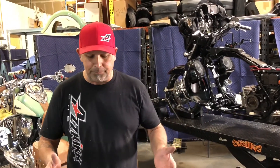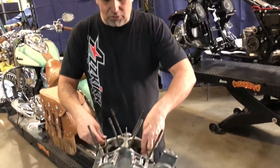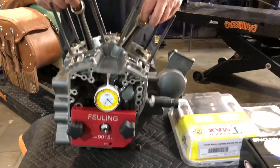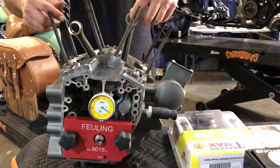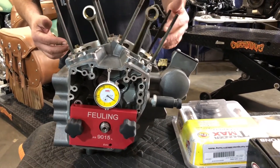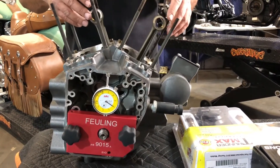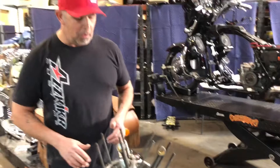So we're at six thousandths here. As we spin the crankshaft around, it'll get to a spot where the connecting rods become locked up. Basically it's where the crankshaft has gotten slightly what we call scissored — something that's pretty odd on this one.